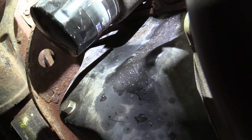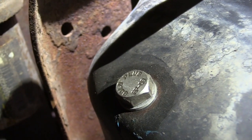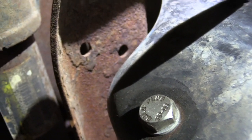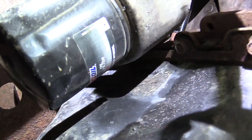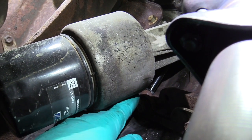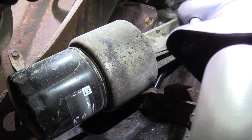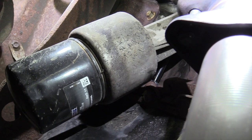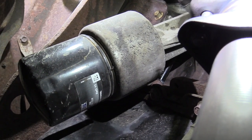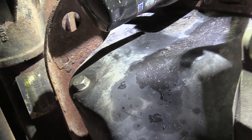We're getting ready to drain the oil out. We're going to take out that gold magnetic drain plug here in the pan and see if we've got that piece of the dipstick tube that fell down in, and any of the metal that may have fallen in from reaming the hole. You can see up there where the dipstick tube is, kind of top of the filter — everything's nice and dry. We've got about 2,000 miles since I put that Banks header system on and put in that new dipstick tube. So we're going to pull out that drain plug and see just what we've caught.